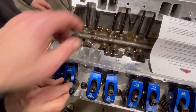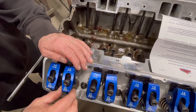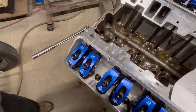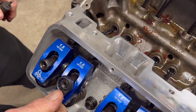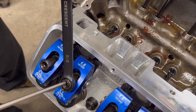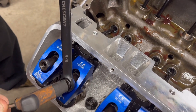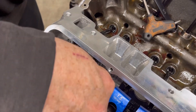Now he's doing the same thing — getting that rocker arm where it's just snug, not pushing the pushrod down into the hydraulic lifter. Just snug. He's going to take the wrench and go half a turn — Scorpion said a quarter to one full turn and we're going half. Then he's going to lock that into place; we're not putting any Loctite on it. Hear it pop like that. Got a little side movement which you can't ever prevent. The preload is set.